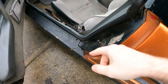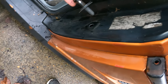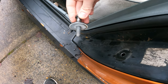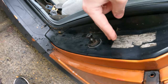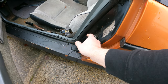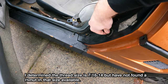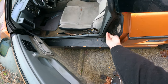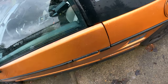Also in the process of trying to get the doors open, the door pin — I tried unscrewing it, and when I went to screw back in, the nut that's inside fell out. I don't exactly know how I'm going to solve that. I might just need to weld it in, or figure out how to get inside to get the nut back in place. I might be able to find the thread pitch and put a riv-nut in there, though I don't know if that'll be strong enough. We'll just have to tackle that once we're there. For now, if I just put it in place and slam the door, it latches.